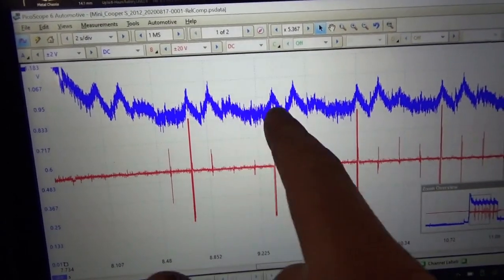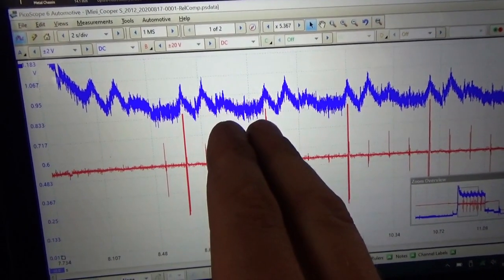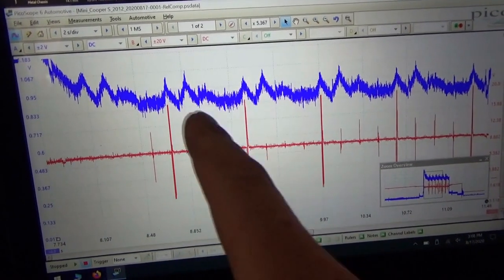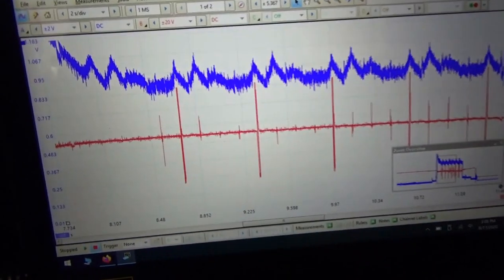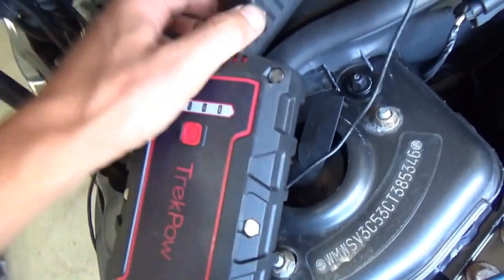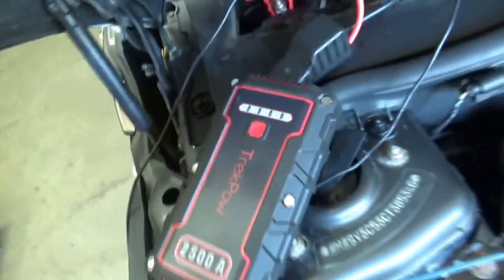Very interesting. What if there's a blown head gasket between them? What are the chances that two cylinders lose compression at the same time? We could get a borescope down in there, look at cylinders two and three, and then do a leak-down check to see where the leak is. Uh oh — I think we found the breaking point of the jump pack. He gave us about five good cranks and then done.